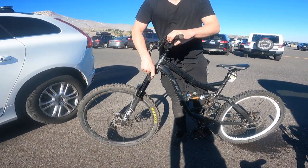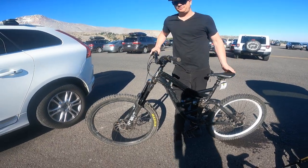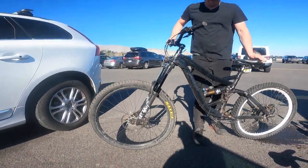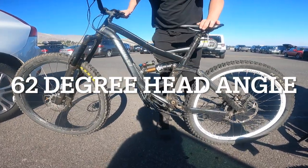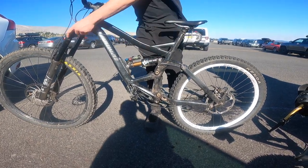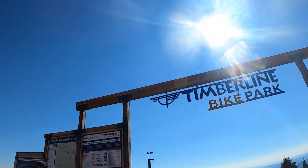Here is the finished product: 29-inch front wheel, Fox 36 fork with 180mm of travel, Shimano four-pot brakes, 200mm rotors front and rear. The best upgrade on this bike is the dropper post — 170mm KS dropper post. Fox Float X2 in the rear, DMR pedals. And oh yeah, the head angle: 62 degrees. So I'm not quite sure if this bike's even going to be rideable at that slack.